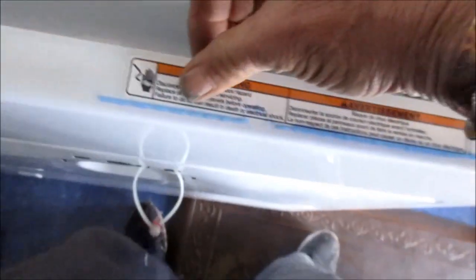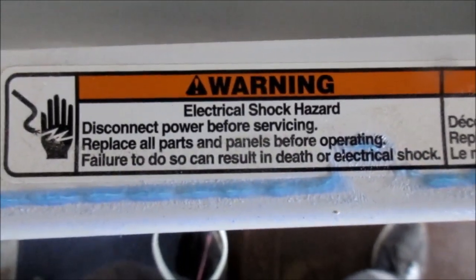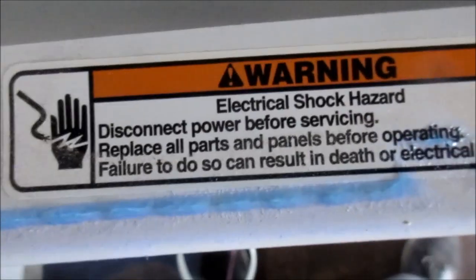To get this thing apart, there are two screws — the felt screws underneath the lid or the lint filter right here on the top. Quick disclaimer: working on dryers is hazardous, consult your local professional. The switch is right here; there are two screws that hold it in and connectors that disconnect — sometimes you have to pry these apart. Unscrew it right up there and that's how you access the switch.